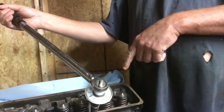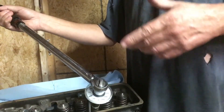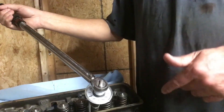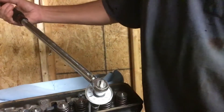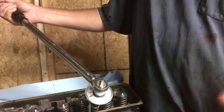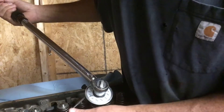The long bolts on this head go 75 degrees. As I've mentioned before, you have long bolts, medium bolts, and short bolts. The medium bolts get 65 degrees and the short bolts you turn 55 degrees. I've got the torque wrench cranked up to about 80-90 foot-pounds because you're not going to reach that — I just don't want it clicking.